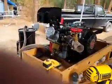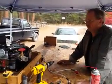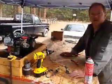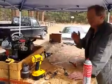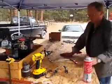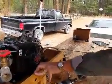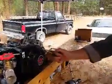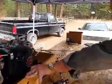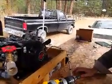Another thing that you need to make sure you have is compression. We did some torture testing early on — basically we didn't purge the gas, we let it get all gummy and then let the engine cool down so it was basically stuck with tar. We tried to run it and of course it didn't run. One of the troubleshooting things we did was grab the pull start and give it a slow pull, and it was a nice smooth pull, which means one of the valves was stuck open — there was no compression. You should pull it and it should be easy at first and then get up to a hard point, as you compress the air in the piston. You should feel that resistance when pulling.